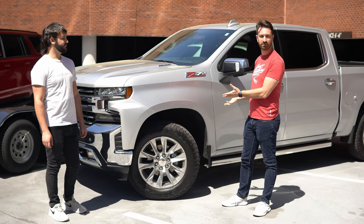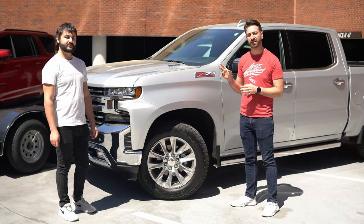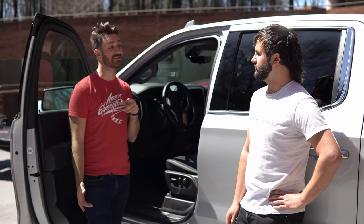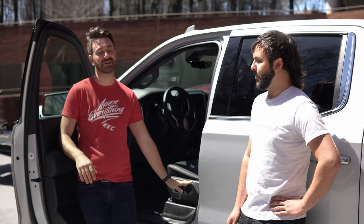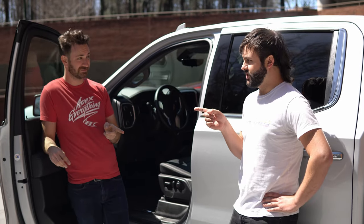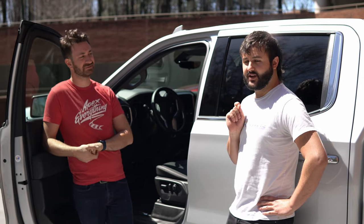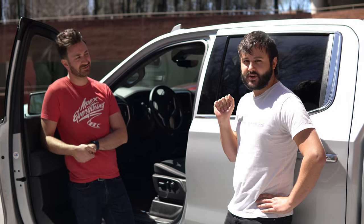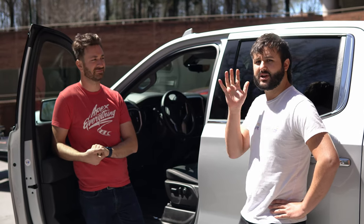The Silverado has about 2,000 pounds more tow capacity than the Suburban sitting next to it. Now, payload — Jake thought the truck would have more payload than the Suburban. But actually, the Silverado has 1,471 pounds of payload versus the Suburban's 1,610. There is a difference to be had in the type of vehicle: this is a truck with leaf springs, while that's a big SUV with coils. That can influence payload, and the SUV is designed to hold more people all the time.